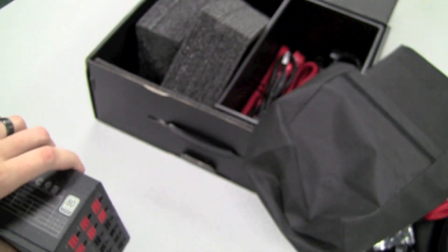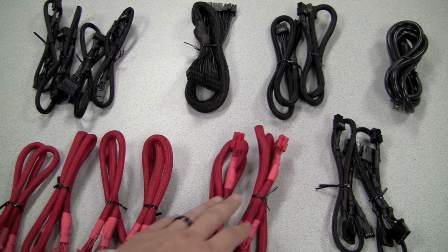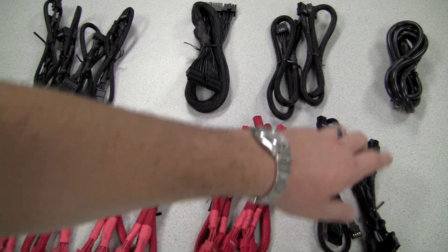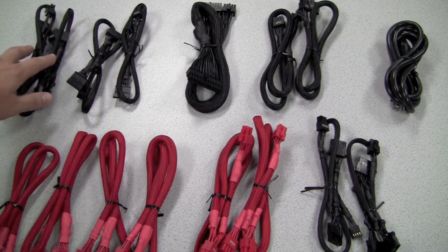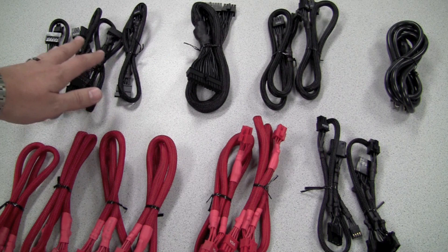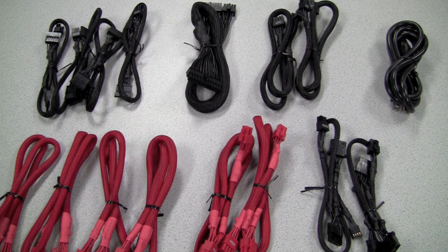Here's a quick overview of our cables that come provided with our 1000 watt. You'll see we got four 6-pin plus 2 plus 8 power connectors and two 6-pin plus 2 power connectors for our graphics cards. Over here we've got a couple of Molex cables for our peripherals, AC power, two EPS 4+4 pin connections for our CPU, our 24 pin connector, and a couple of Serial ATA power connections — a total of 10 power connection cables for our peripheral devices. With the modular design, you can plug in only what's needed and leave the remaining cables in your tote bag for a clean look and better efficiency.